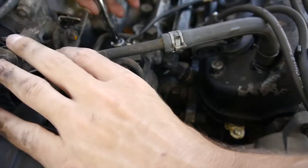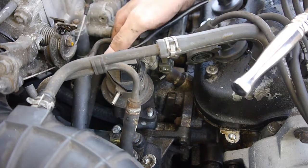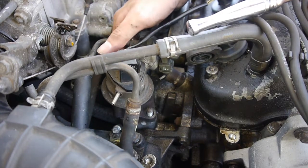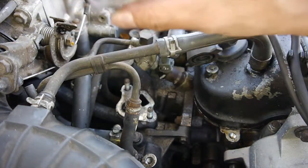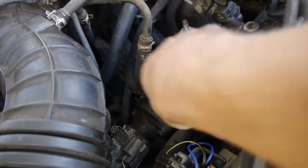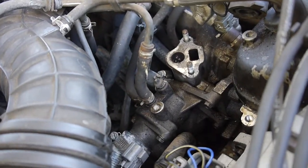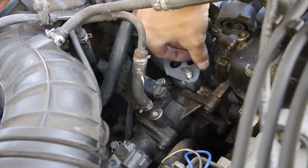There's one bolt here. The new piece comes with this new gasket, so don't forget to replace it with the new one. Okay, I just got the old valve out. Now I'm going to put the new one back in. It's pretty straightforward — two 12 millimeter nuts. You can see them go here and here. Gasket goes on right here. Boom, there's that.